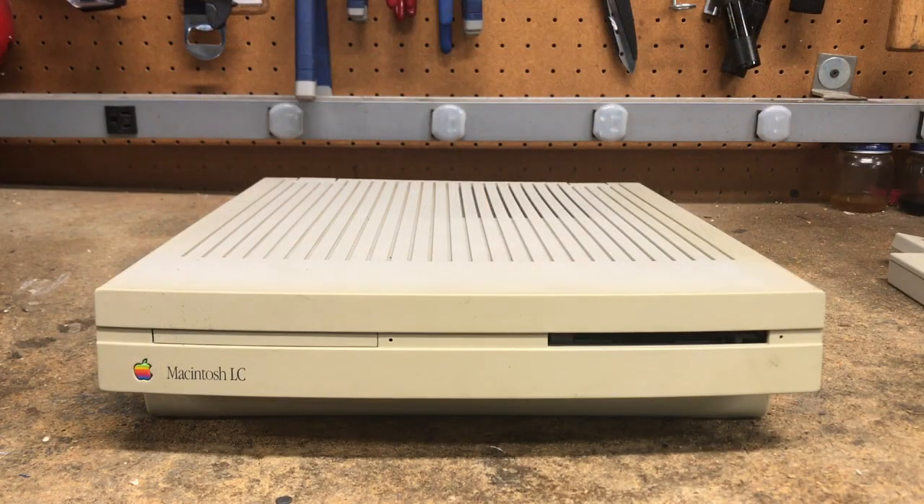Here's my personal Macintosh LC from 1990. I'm not a stranger to Apple computers — I've had a 2E since 1983, but this was my first Macintosh computer. I purchased it my freshman year of college using my student discount. At the time it was the lowest cost color Mac. It has a Motorola 68020 16MHz processor, and although it's a 32-bit CPU, it was choked down by a 16-bit data bus, most likely so that it didn't chip into the Macintosh 2's market. It comes stock with 2MB of onboard memory, but I did add an additional 2MB for a whopping 4MB. It has a 40MB SCSI drive and a 3.5-inch floppy drive up front.